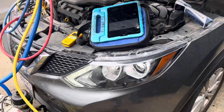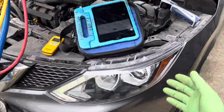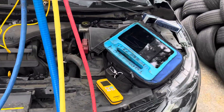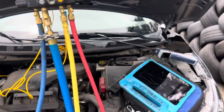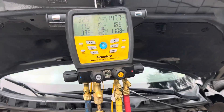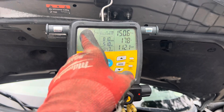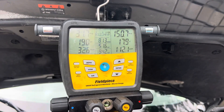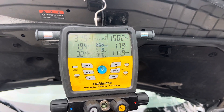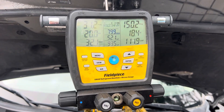Windows open, fresh air. We're putting out tons of water and I'm sorry I can't give you a temperature reading right now — I should get that. I'll snapshot it and put it up on the screen. I just want to prove a point here. The temperatures basically do not change, the pressures are steady, and you can see the superheat and subcooling going down from the 17s up to 21 — that's the variance of the variable displacement compressor. I'm going to shut this off and we'll start the next video. See you in a minute.